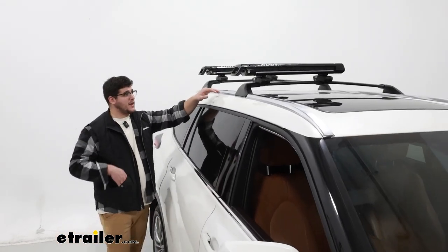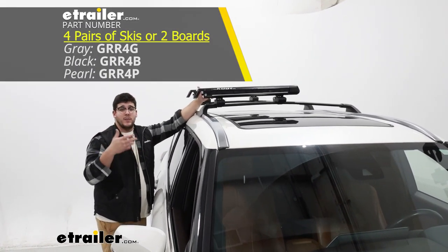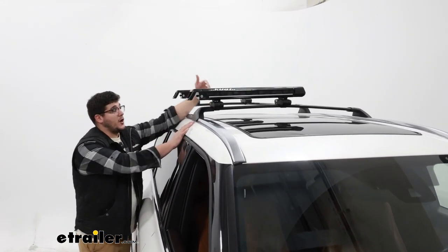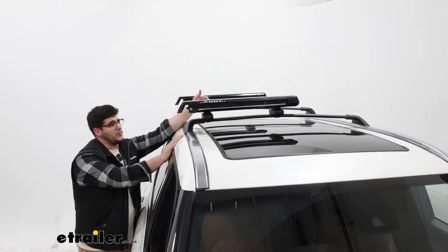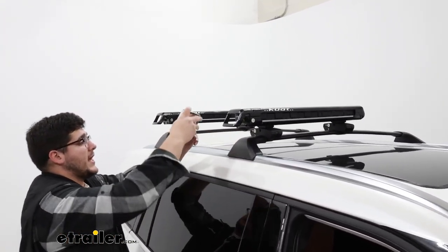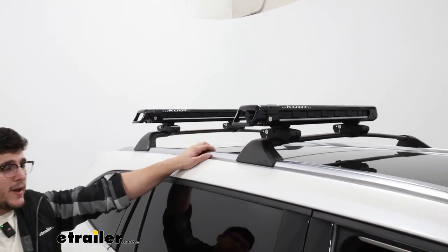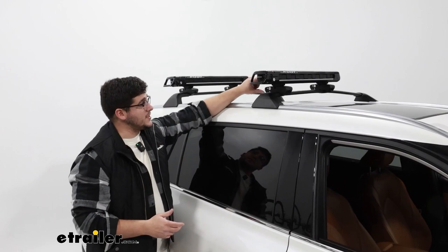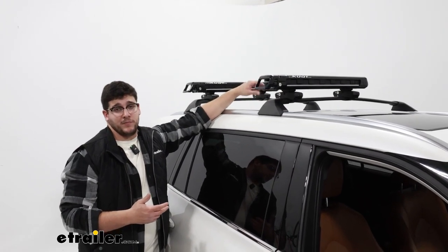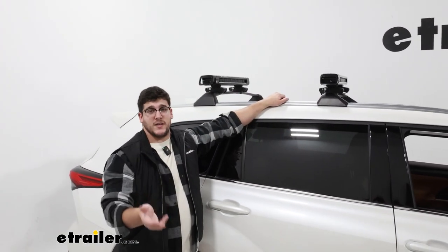As for how these are going to sit up here, they're going to take up a decent amount of space width-wise. The carrier we have today is the four ski and two snowboard carrier, but you can upgrade to the larger size which is the six ski and four snowboard carrier. If you go with that larger option, it's probably going to take away more space so you won't be able to put any smaller accessories up here either. As for the height, that's going to be from the top of our crossbar to the top of the carrier — just about four inches, which isn't too bad. It is a little high, but that's actually kind of a good thing since these clamps are fairly large. If you have any skis with taller bindings, that's going to give you a little bit more room to play around with. Since we do have factory crossbars today, this is going to be at a 32-inch crossbar spread, so just make sure you can get your skis on top of that.